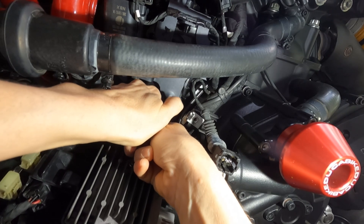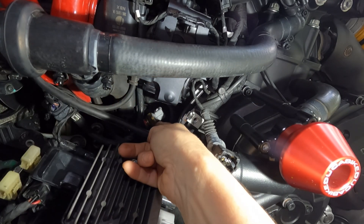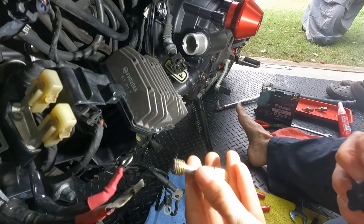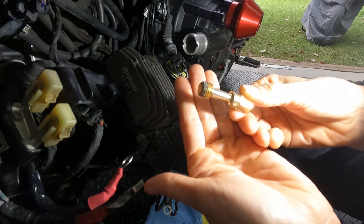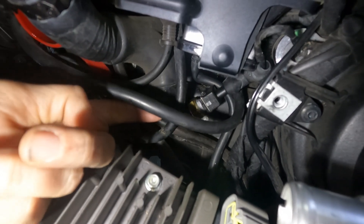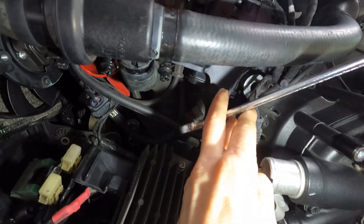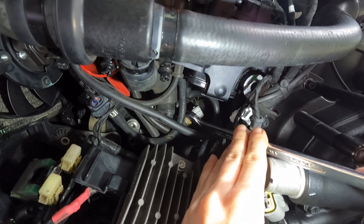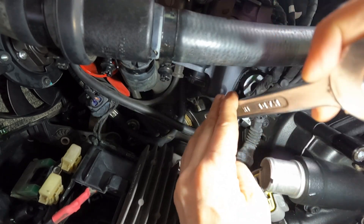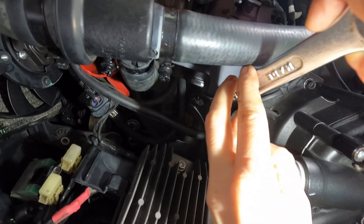I couldn't get the sensor started in the thread. After a few moments of panic that the original sensor was cross-threaded in there, I chased the thread and managed to clean out quite a bit of gunk, which was probably from the original Loctite — and that did the trick. Then I tightened the sensor in by feel because there is no way known to humankind to get a torque wrench in there without pulling half the bike apart. I had paid attention to the force it took to get the old sensor unscrewed, which felt not loose but certainly not as tight as the 23Nm the workshop manual specifies. The old sensor didn't leak at whatever torque it had been done up to, so I'm pretty confident I leaned on the new one enough.